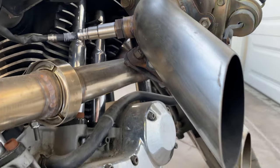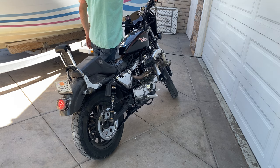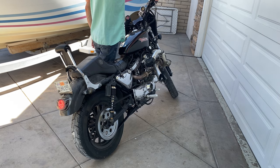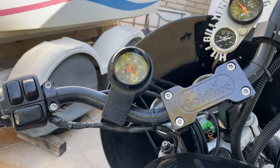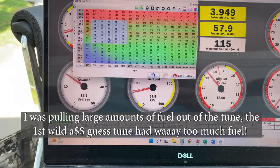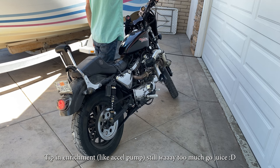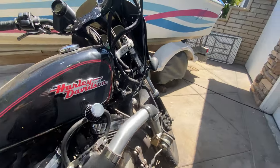I added a wideband O2 sensor which is connected to the micro squirt, but it also just helps me see what my air-to-fuel ratio is. These first few starts are guess and check before I can use auto-tune — I've got to get it running at least well enough to idle. A few hours later she's purring like a kitten, not smoking like a freight train as much. At idle here I'm trying to see how big a smile I can put on my own face, because twisting the throttle and watching clouds of smoke exit these pipes just makes me happy — sue me, hippies.